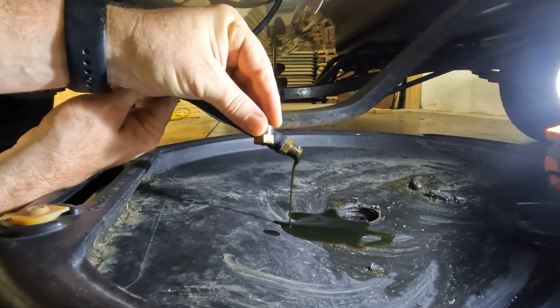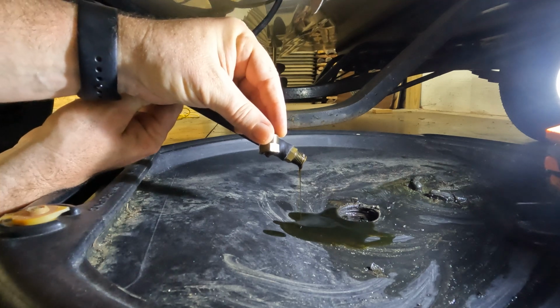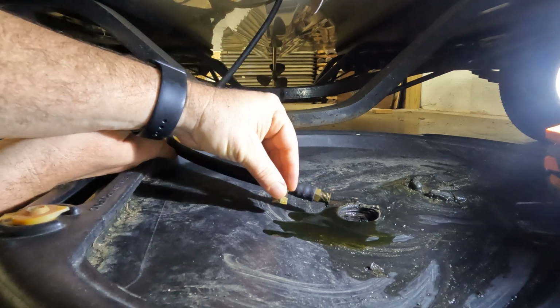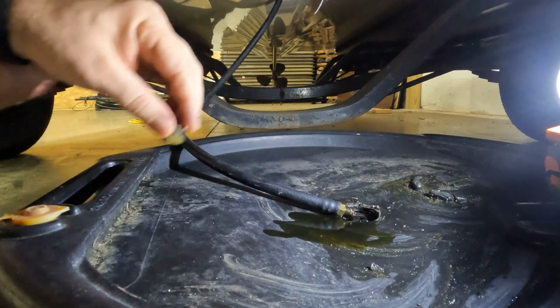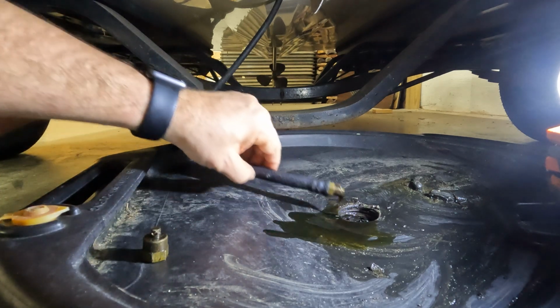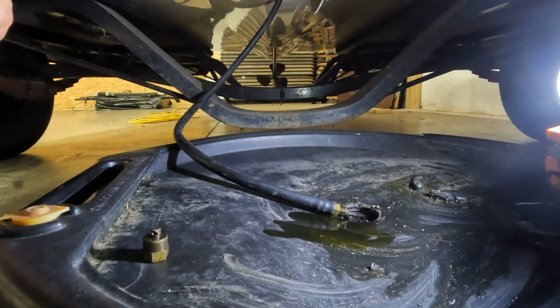But since it's been in the boat here for 2 years, it's a good idea to dump it out. This was just regular conventional. This was T4 Rotella oil. And that's why I can't trust it 2 years later here in the boat to protect that PCM engine. I'm going to let that drain out. It's going to take quite a while because the oil is cold, the engine hasn't been running, and it has to drain out this small hose. We'll check back in a couple minutes.